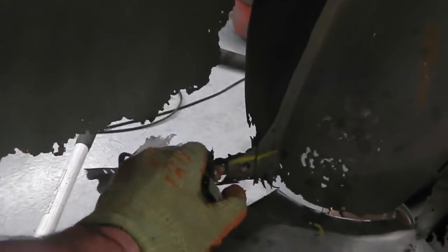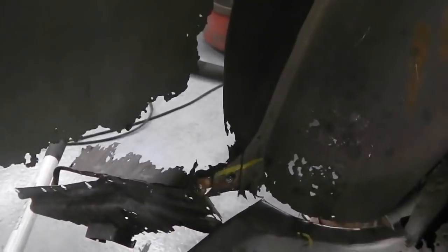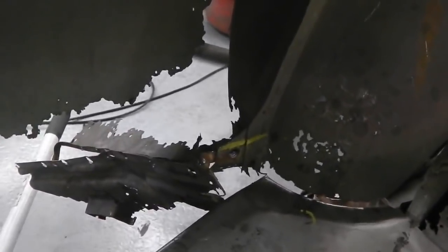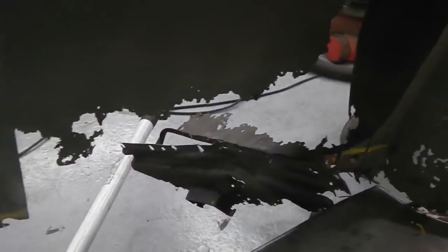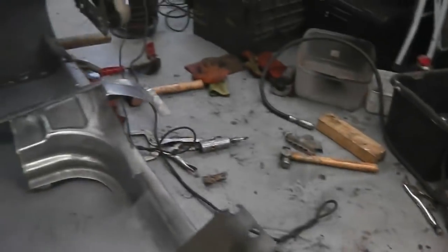That's that one gone. I'm just going to leave us the attachment at the wheel tub, which we're now going to cut. The end of the sill attaches to the wheel tub, as does the inner sill. We've completely removed any affixing points for the inner sill, but we haven't removed the final welds that hold it to the bottom of the wheel tub. So rather than do that, I'm just going to slice that piece off for now. Then, because that's all out of the way, we're going to clean the remains of the outer sill off the wheel tub back, and then offer both parts, inner and outer sill. The reason I'm going to do that is to make sure that when we fit this,